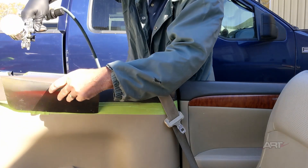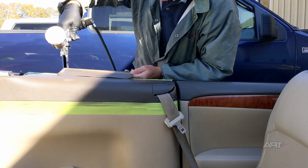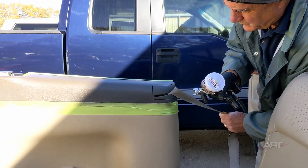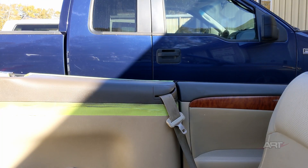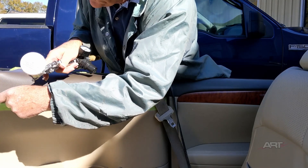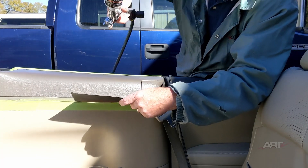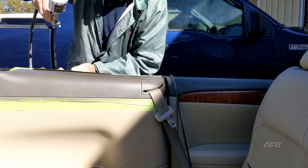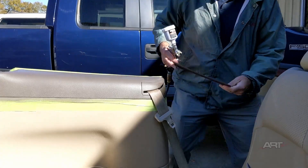Here I'm using the plastic primer as a base for my pigments. Bear in mind that plastic primer is very brittle when it dries. If it's going to be too brittle we could run into a problem, so instead of using plastic primer directly you might opt to add a little bit of leather base to give it more flexible properties, or add some flex additive to the plastic primer. If all of that is too shiny — and plastic primer is shiny by default — you can adjust that by adding a little flattener. It depends on your target color and target sheen. This is such a durable product that I don't usually concern myself with putting a clear coat over the top.